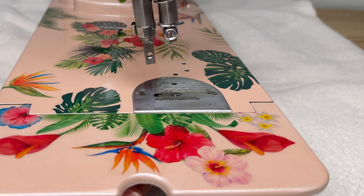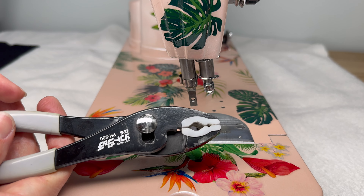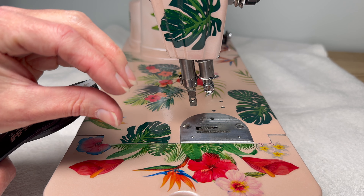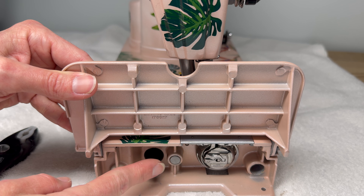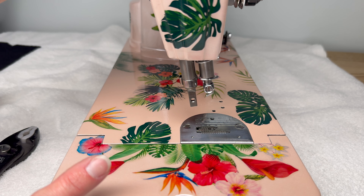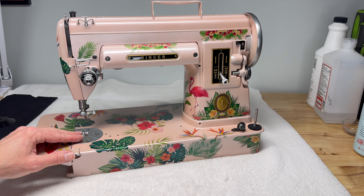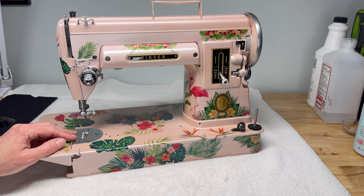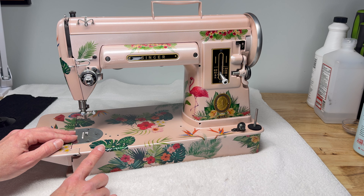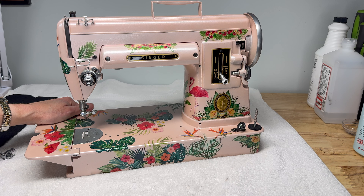So that is how the drop feed feature works on your machine, and usually it's pretty easy to fix. Usually you can get it turning with a pair of non-marring pliers — if you don't have those, regular pliers are fine, just put a piece of cloth between the pliers and the knob so you don't scratch it. What an awesome feature for a 301 — truly I think it makes it a nice competitor to the featherweight, absolutely without a doubt. When you're all finished, put your bottom cover back on and you should be good to go. Thank you for your patience on this promised video. Please give this video a like and subscribe for more content like this. Check out this beautiful 301 right here in my shop. I'll see you again really soon. Bye.